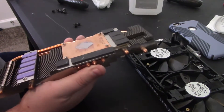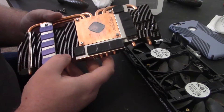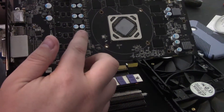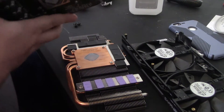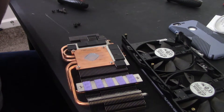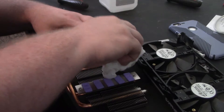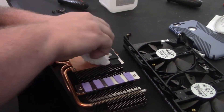The reason I want to show you this is these have thermal pads, and if they're coming off you want to make sure you get them on as close as possible. You really don't want to touch them. They go over top of things like VRMs — these purple ones right here cover these VRMs, so it's very important that they're really accurate. There are also thermal pads behind the back plate because there's more chips back there. Be very, very careful that you're not playing with that stuff too much, because you definitely don't want any grease touching the thermal pads. I'm going to give these a quick rundown with some isopropyl alcohol. There's actually some thermal paste going on — you don't want to push too hard because you can start eroding away at the thermal pads.